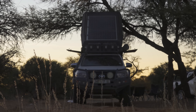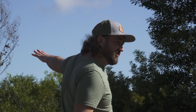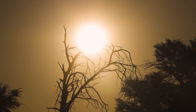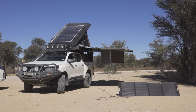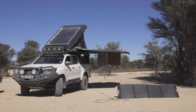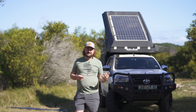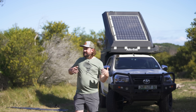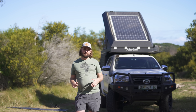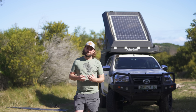I'm in a privileged position where I get to have both and it's really the best of both worlds. I get that constant trickle charge no matter where I'm parked, but if I want to put the blanket out and top up in perfect conditions, I can do that too. And the blanket means I can loan it to friends while still getting charge from the roof panel. At the end of the day, I don't really need any of this because my 40-amp DC-DC charger tops up my batteries so quickly, and I'm not one to sit at the same campsite for days without moving — but it's nice to have, and these panels are so light there's really no downside now that it's paid for and installed.